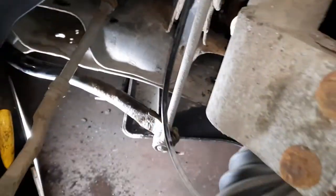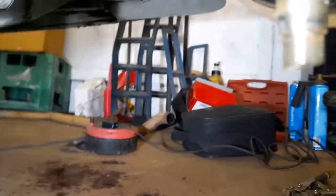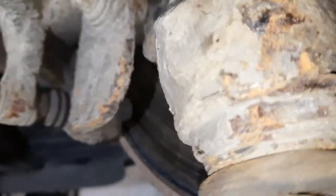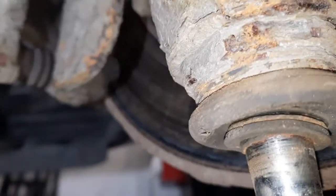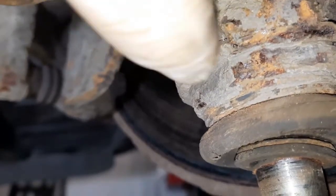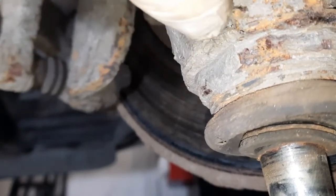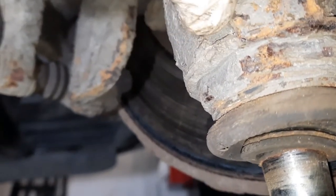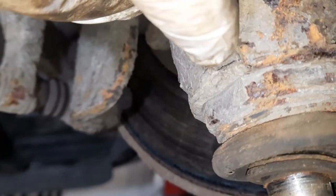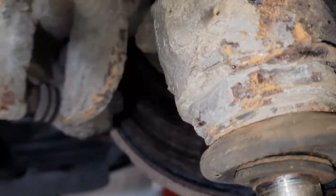The next thing is to turn my attention to this ball joint — it screws in. Normally there's a little nib on it that's been hammered down, and when you screw it on you stake the edge so it can't unwind itself. So the first thing I need to do is get a little blunt cold chisel and knock this down so that I can then attempt to unscrew this nut. So that'll be fun.